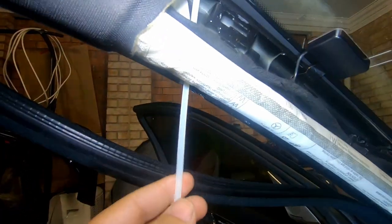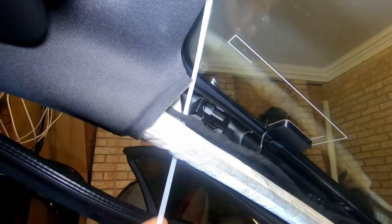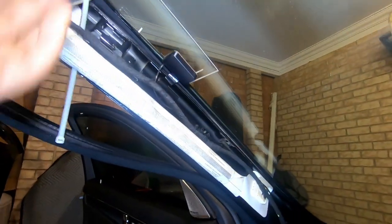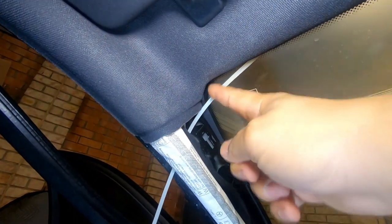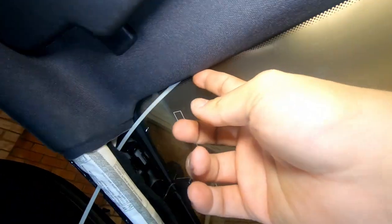Once you get here, notice how this hose tie then passes through — that's how you would push it through in order to get it to the roof lining again. All you'd have to do is pull it a bit tighter and the camera cable will get tighter and fit up here. From here it's just lining it to the roof lining, tucking it in all the way, past here.